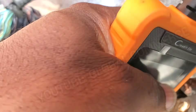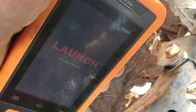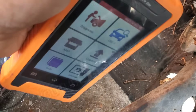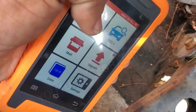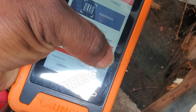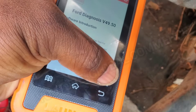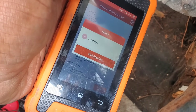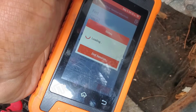So I just plugged in our scanner and it's actually booting up. This scanner gets power from the OBD port and it's getting powered directly from the Ultimate CAN Bus Tester. This is the advantage — this is one of the reasons why we use the Ultimate CAN Bus Tester. Because we can go anywhere under the vehicle; it doesn't matter where we're at and access the CAN lines. So we're going to go to Ford, tell it OK, and try to scan the vehicle and see if we can communicate with any modules on the CAN bus.